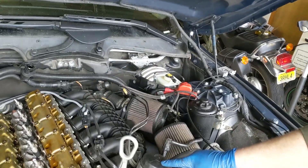When you're losing oil pressure, your bearings are going to wear — your cams, rod bearings, crank bearings — very quickly. You can even spin a bearing. I did start it up briefly and it did not sound like it was knocking or making any weird noises. After letting it sit for a couple of days, it did have full oil, though there's now a big oil leak from the crank seal. I'm very hopeful there's no bearing material in the oil pan. I'm going to open up the oil filter and cut it out to see if there's any shiny metallic stuff in there — probably next video.